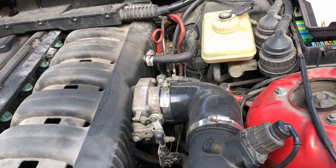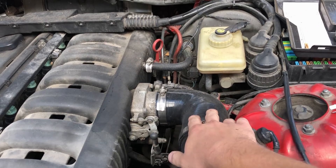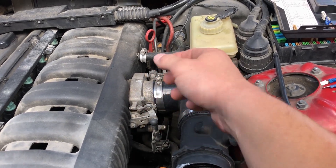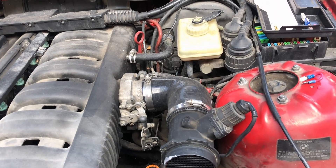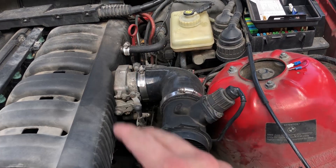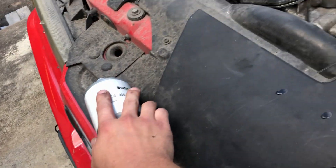It does look like it'll be easier from the top side, so I'm going to pull this boot back off, probably pull the throttle body off just so I can get back in there. There's a clamp that goes around the fuel filter, so I'll have to loosen or remove that, remove the two fuel lines, and then throw the new one in.